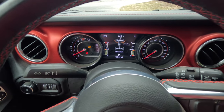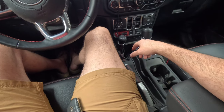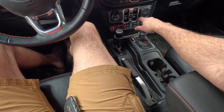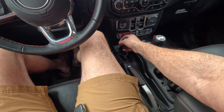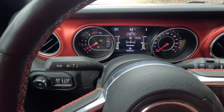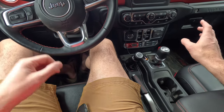The first thing we're going to do is put the vehicle in four-wheel drive. This can be done while you're in park or while you're in drive. I'm going to go ahead and put the vehicle in drive. You're just going to take the shift lever and pull it towards you. You're going to hear a little noise, you're going to see the four-wheel drive indicator, and then you'll see a little lock on the transfer case — that means the vehicle is in four-wheel drive. You now have a couple of modes available.